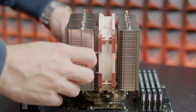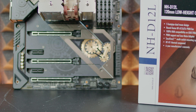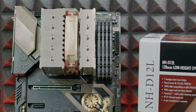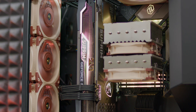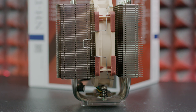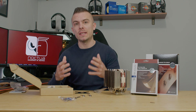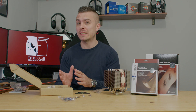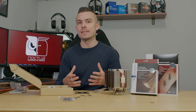One important thing to mention: this CPU tower cooler fits many 4U enclosures, making it outstanding for servers, and it also fits narrower tower cases that were previously limited to 92mm fans and coolers. Most 120mm-based CPU tower coolers go up to 155–158mm in height; this one is 145mm, which gives you more variety and more possibilities for placement.